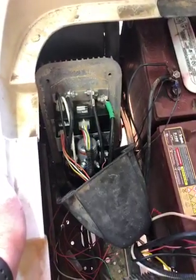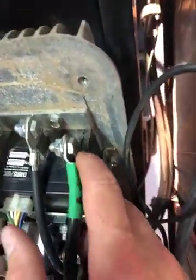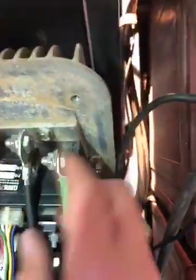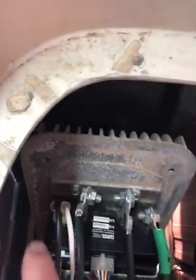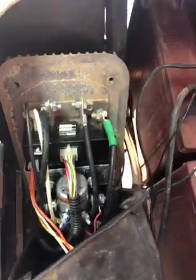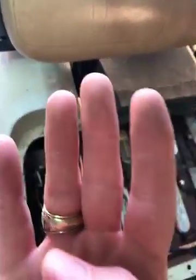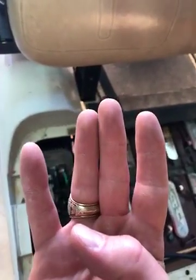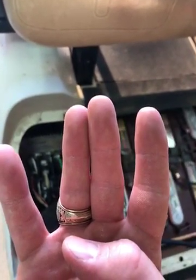What I ended up figuring out is that my Curtis controller was bad. I took all the wires loose, unplugged everything, and got this thing on my workshop bench. There's another video that shows you how to disassemble these Curtis controllers. Essentially you start on this seam line and pry all around the top, then down the sides, and you can eventually get that top off. What I found is right behind that four-pin connector there were four diodes sticking up. The middle two were leaning together — when it was cool there was just enough room that they weren't touching and it was working, but when it got hot they swelled together and it wouldn't work.